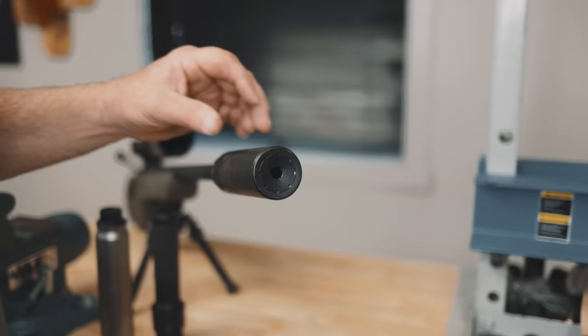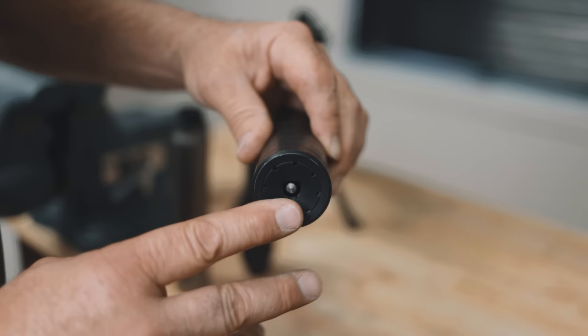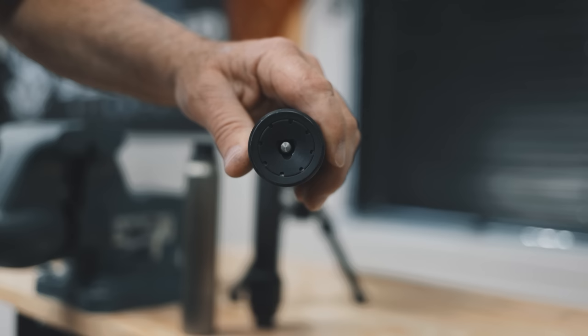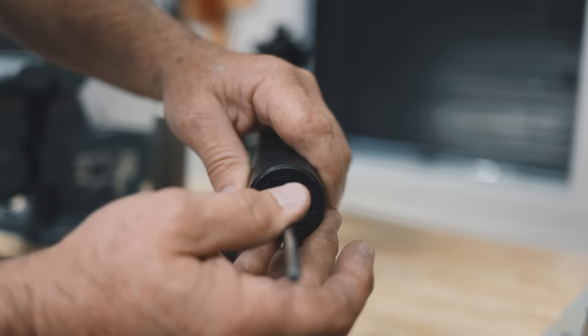Let's screw them on and take a look at that. I'll gently ease the rod down so I don't scratch my rifling. I like to get it kind of flush with the cap just to take a visual. Take a look at where that rod lies in there — you can plainly see it has well over 20 thou. This is going to be the test you're probably going to do most. I'll pull the rod out a little bit — there's quite a bit of play there, but I promise that won't affect it at all.